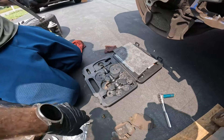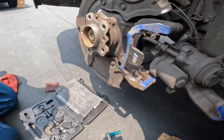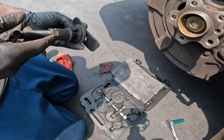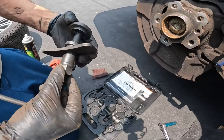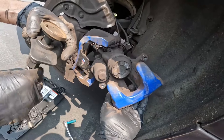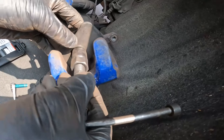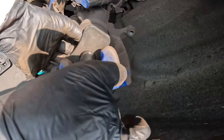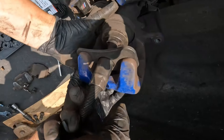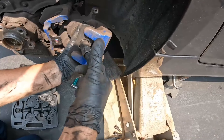We're using number six from the kit — it has a two-hole configuration but fits well. Set it up, slide it over the back side, bring it all the way down and line up with the notch — it's almost the shape of a brake pad. Then unscrew it until there's contact and slowly screw it in; the rotation actually locks the gear on the inside.